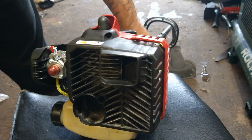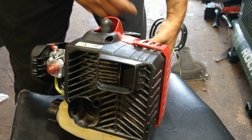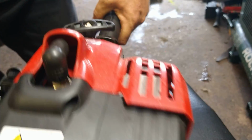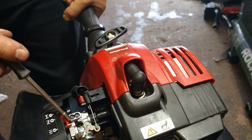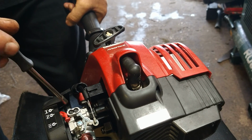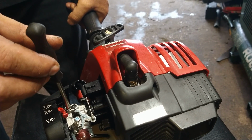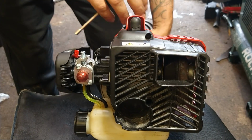Alright, so off choke, it doesn't want to run properly. It's wanting to bog out. You hear it when you give it throttle, it's trying to bog out. There's a couple of adjustments. They are right here. You've got high, it's got an H above it, and low below it. We're going to go for the high. We're going to go with a Pac-Man screwdriver. I'll put this in the description below. You're going to go counterclockwise about a quarter turn maybe, and we're going to try it again.